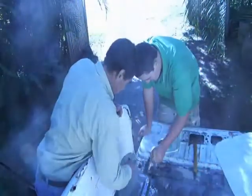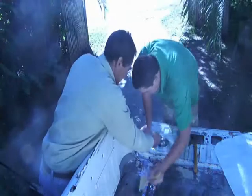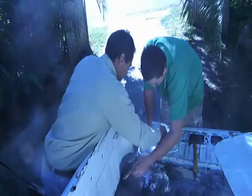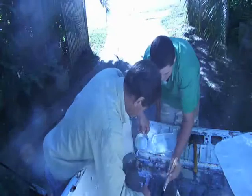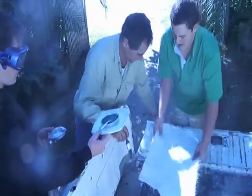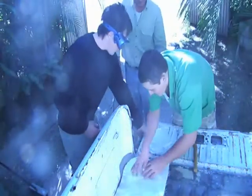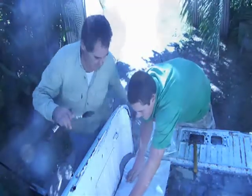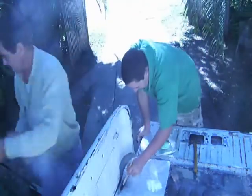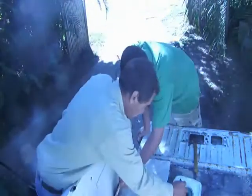So we're just putting a nice thick coat of resin onto the steel. We'll then place the mat over this coat and pat the mat into it with other coats of resin. Here you go. Because it moves around and forms to the corrugated shape of the tray, whereas we would have had no chance of doing that with a weave.